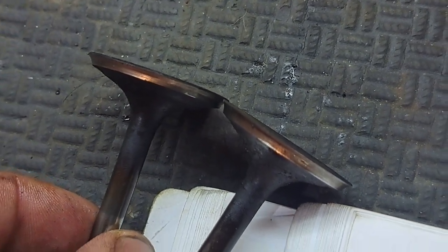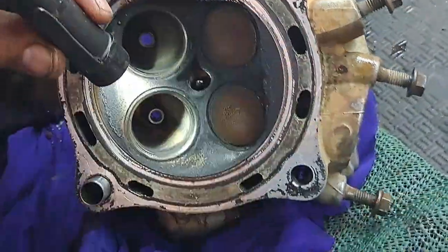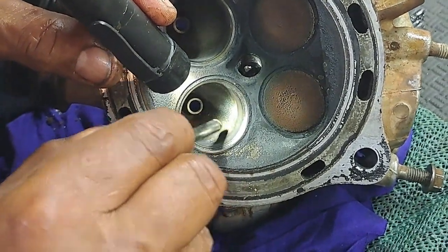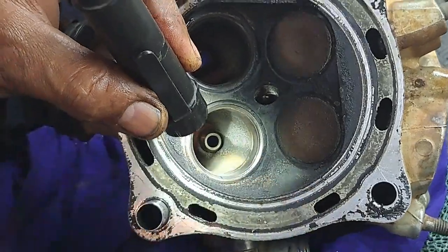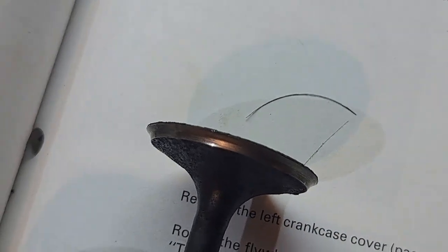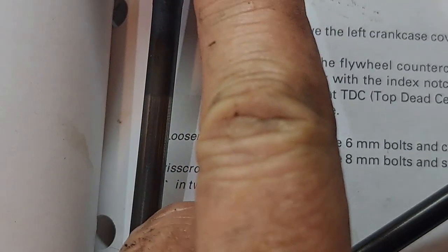You can see this stream and puddling there - oil going in and puddling because you're on the side stand so the oil goes to the left. Something was coming out of there and leaking ever so slightly. I said that was a hair - it's not, that's a small sliver of valve. We were overdue. This is the new Kibble White we're gonna put in. See the meat - it's hard to see but what your finger tells you is that it could cut you.